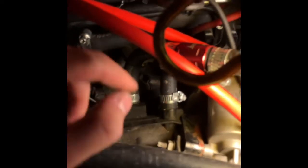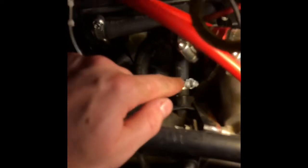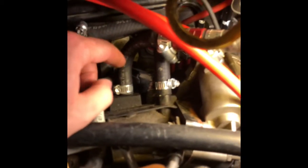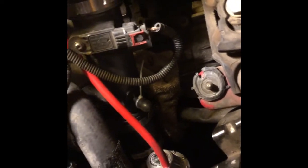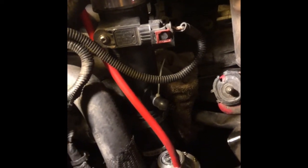The reason why I had issues with running the hose at the line is that this nipple is, I don't know the exact size of it. I know it does fit this 3/8 hose on it, which is hard because if you look at the blow-off valve, under here is where there's a little pipe that comes off the back of it. It's a little feed line in it, and it's super tiny. I mean, the 4mm right here fits on it, but it kind of slides on.